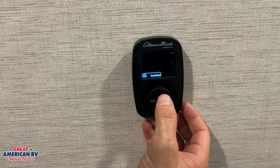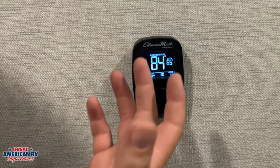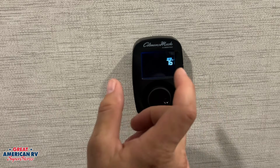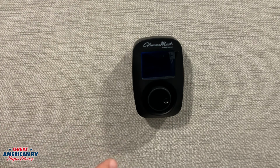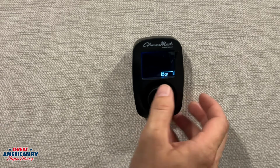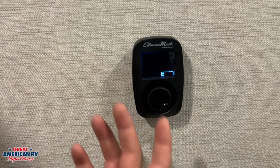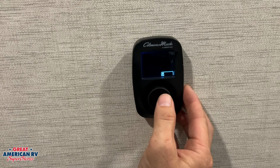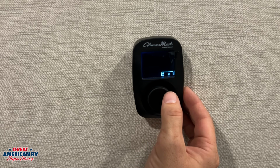Our next mode is our cool dry mode. So basically this works as a dehumidifier. We go ahead and choose our set temperature and we're going to notice that this system runs based on that set temperature, and it's going to help keep the moisture out of your unit. And we go into our off mode and then we can actually just have just the rooftop fan running, meaning it's not cooling, we're not heating, we're not anything. It's just that rooftop air circulating air throughout our unit. So we can choose high or low and just that rooftop air fan will be running.